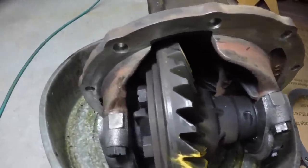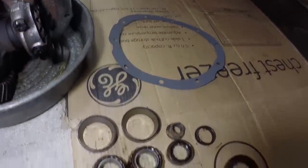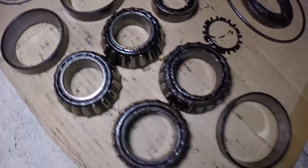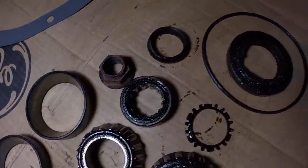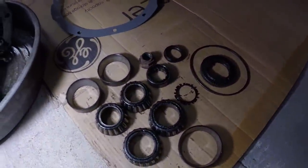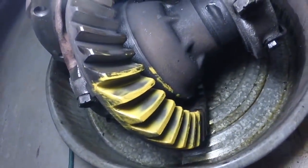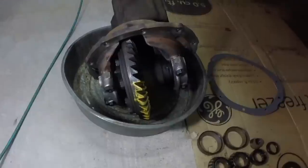He said it was in really good shape. All new bearings — this is the new gasket it came with, but the bearing races. I'll keep the stuff with the car so when I sell it, the next owner can have it all. That's the crush sleeve. If people over tighten their pinion nut after changing their seal and crush that too much, you pull the pinion gear away from the ring gear and you change that tooth pattern. You can actually damage the differential by doing that.